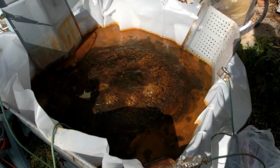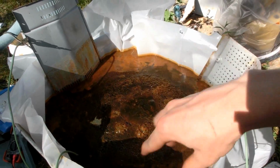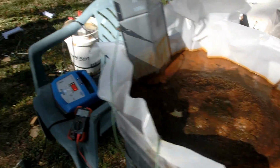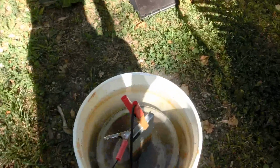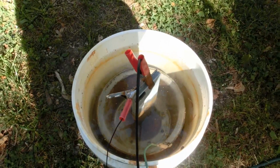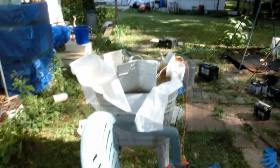Unfortunately, this just wasn't fast enough. So I took out this inner electrode, so this tank is only working on the outside of the rim. And over here I have another rim going, with that electrode in here, so there's one working on the inside of this rim. That way I can work on two rims at a time. Whenever that one's done, I can spend time cleaning the outside, and whenever that one's done, I can spend time cleaning the inside. But then I have less downtime and it's going a lot faster.